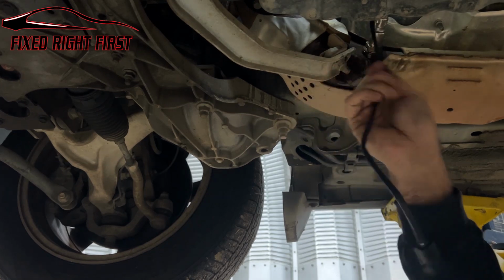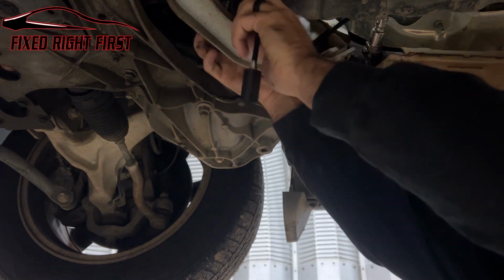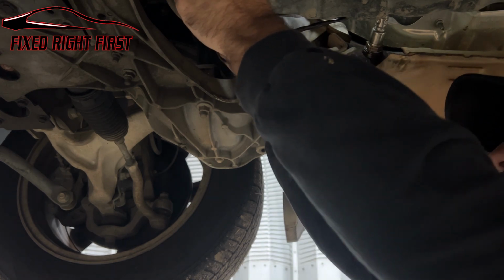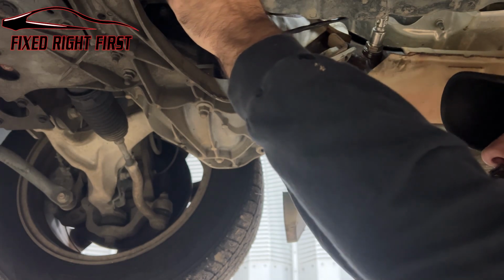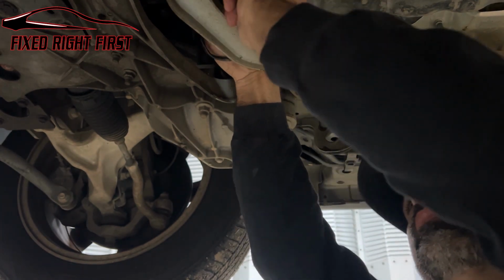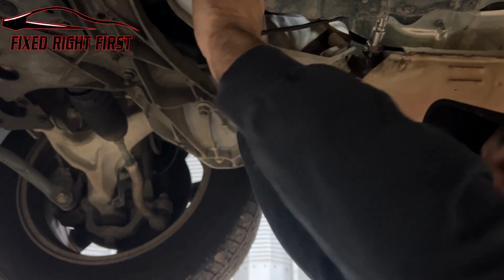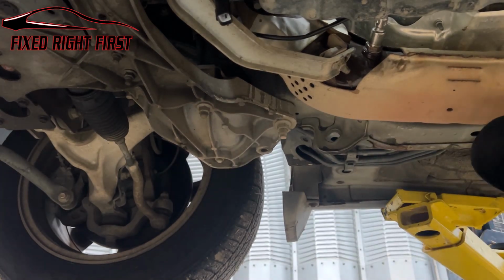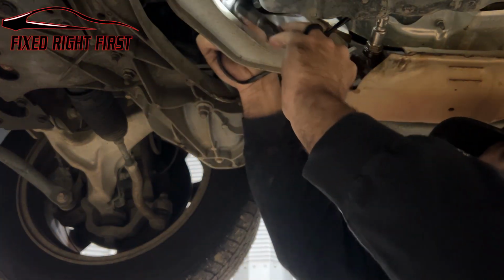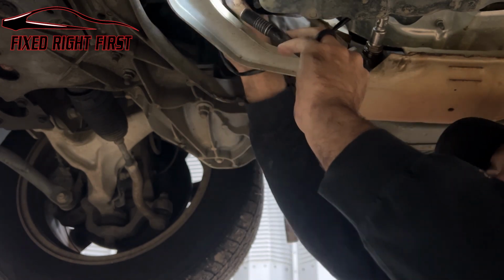Put it in. You got a holder right here for your oxygen sensor wiring harness. It's going to go across there. It's going to go to the top and connect in. I have no light right here, so I can't hardly see it. Here we go. Now we're cooking with grease. Push it in until you hear it click, then you're going to want to pull on it.